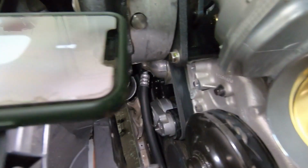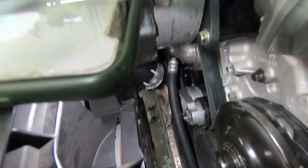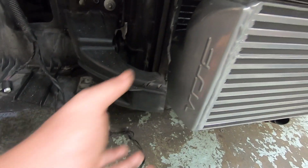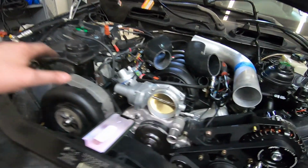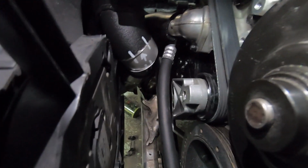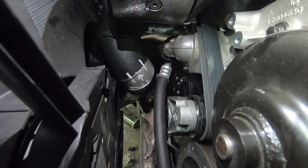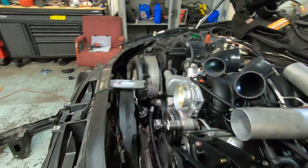It's going to be difficult to show, but on the blower itself, Mike had already modified the cover on this Procharger so that it would work with a standard 3-inch intercooler. He was using one of the ones where it came out right here, and he was kind of going around, and I think he had planned on going through here and up under. So this was at kind of a weird angle, and we thought just a 45 would work, but what I ended up having to do was make a cut through his last radius weld, the last piece that he had welded to it to make his turn. I just cut through that and had to add a pie cut in between, so it's just kind of chilling there. I've got it marked so that we can tack it up, but everything fits.